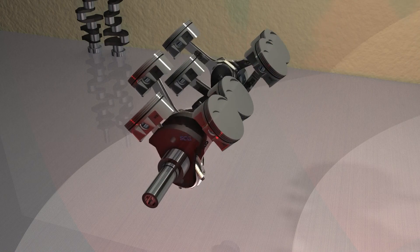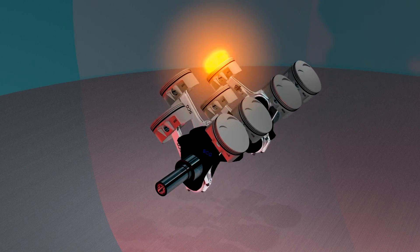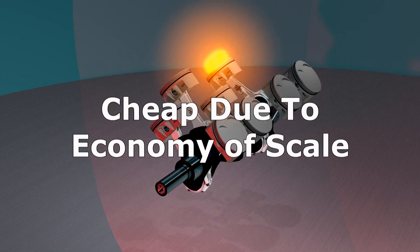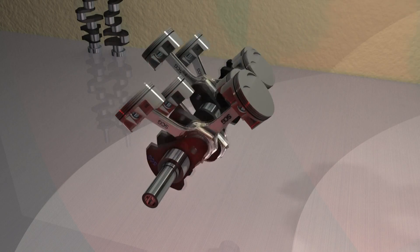The main advantages of the cross-plane crankshaft are: number one, torsional loading is better distributed over the power stroke rotational average — the crank is smoother; and number two, there is a huge acceptance in the American V8 community for this type of crankshaft. The main disadvantage is that they are heavy. Here's the sound of an infamous American V8.